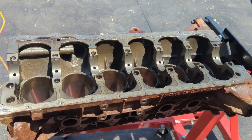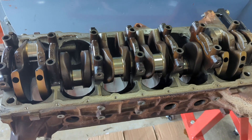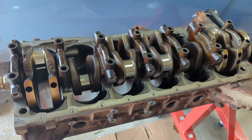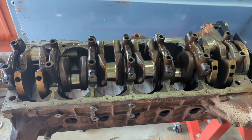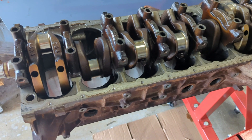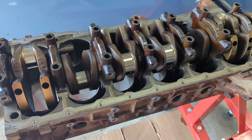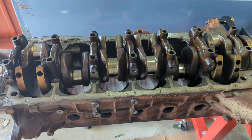Ready to put the crank back in. Crank and caps are back in. I don't need to put this crank back in but I don't want it sitting around the garage ready to get kicked over or knocked over. What's next is to start deburring the block — some of the sharp edges, any casting slag will also come out — and then it'll be ready to take to Dandy Engines.